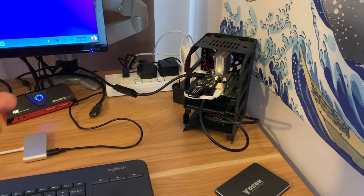And you may have noticed that I was using USB 2, which is going to take longer, but because I'm using the main operating system on the USB 3 socket, I didn't want to plug another drive into USB 3, because I've got a total of three drives connected and my mouse keyboard to my 8GB Pi 4, and it's just too much juice. You'll find that your operating system will crash unless you use a powered USB hub.